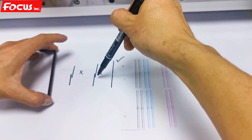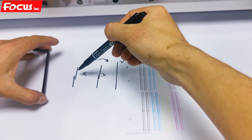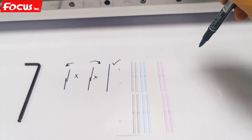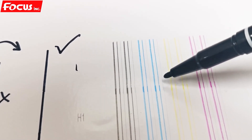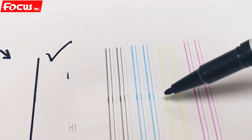If the print out picture looks like this — shifted — we must turn the print head to the right. If it prints like this — shifted the other way — we must turn to the left. When we see the picture clearly, we can see it has a little bit of overlap. We go to the print head and of course we adjust the color print head.